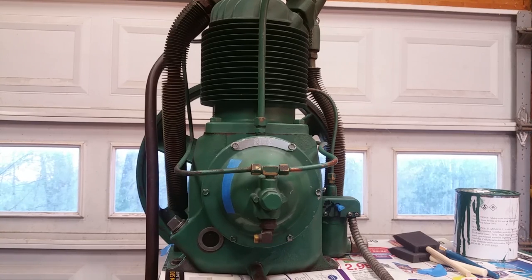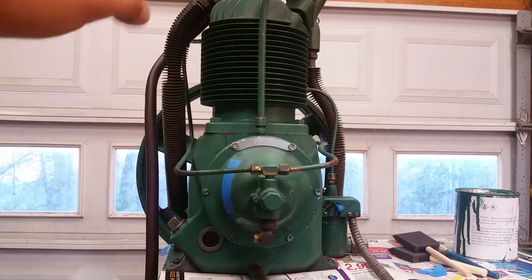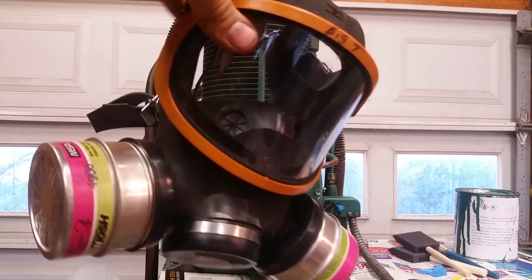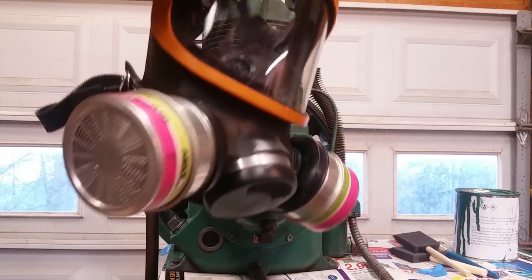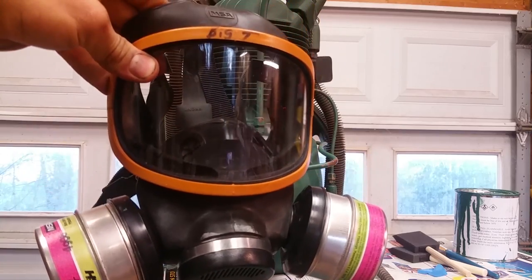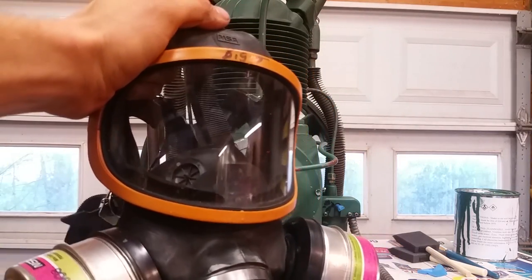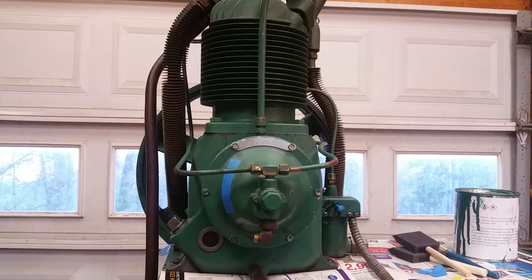All right, now it's time to paint. I got it all cleaned up — rubbing alcohol first, then acetoned it, and there's no grease on it. This is the mask I wear when I paint — it's a heavy-duty respirator. You can't smell anything through it. You don't want to be in an enclosed space — I got the shop door open. A lot of guys paint without a mask, but I'm not breathing that stuff. I'll fast-forward through the painting.